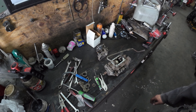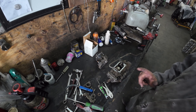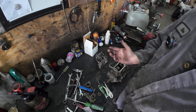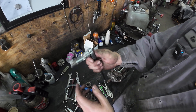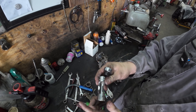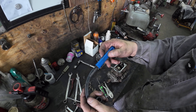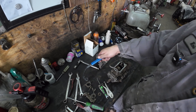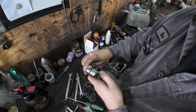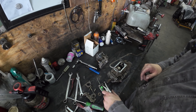Over at the pump here - this is actually a different pump than we had out last time. I wanted to show you a couple things. If you want to crank your timing up, a couple tools that are really nice to have: just a general tool set - I call it a Fisher Price tool set - one of these 17mm line wrenches or line sockets. This is a Snap-on one but you don't have to have Snap-on. Also this wrench for loosening your injection pump - it's a Blue Point SP144, and the Snap-on number is FRXM17.